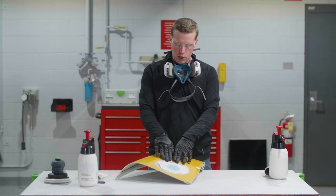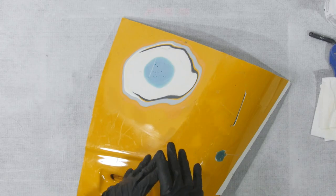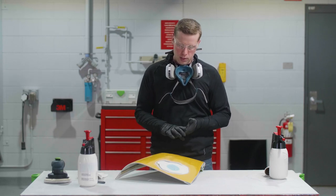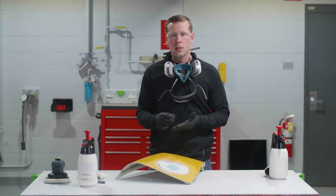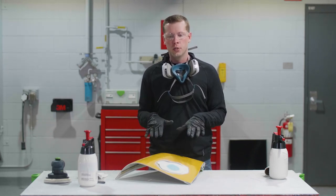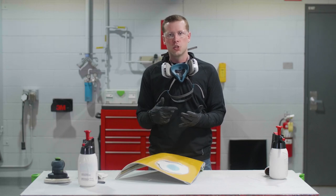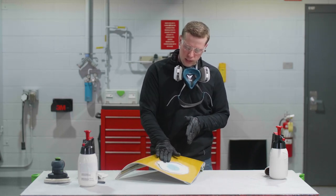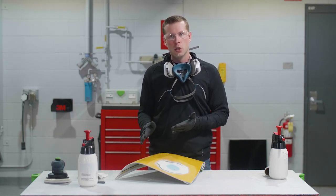Number seven, sanded composites. After completing a composite repair, we clean the entire panel with a water-based cleaner followed by a solvent-based cleaner before beginning the sanding process. During sanding, we can use dust extraction. After completing the sanding, we have some special considerations — at this point we no longer want to use any liquid cleaner, whether solvent or water-based, as it can lead to issues like blistering and pitting. The cleaning process at this stage simply entails using clean dry air with an air blower in conjunction with a paper towel, similar to raw plastic.